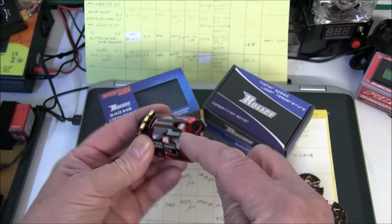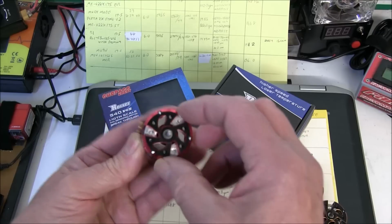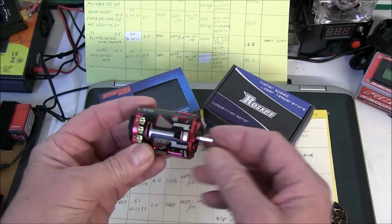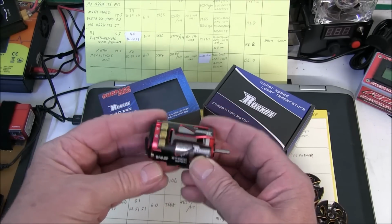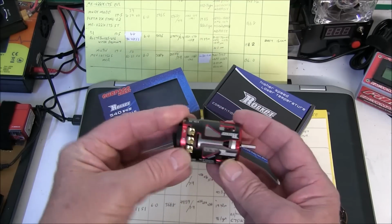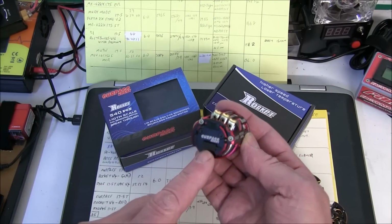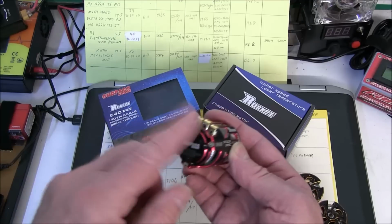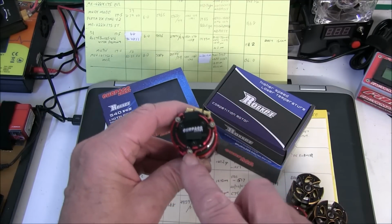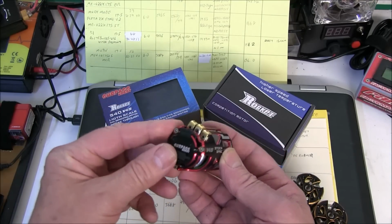Now the S version has the best collector at the front, which is a big aluminium collector, which seems to give exceptional performance in motors. We've seen it in the R1, for instance. Nice big tags for soldering, riveted so they don't move about. Some gaps, so soldering made easy for you. End bell, 2 sensor ports, makes it easy to fit in all sorts of cars. Even come with aluminium long screws, which you normally have to pay extra for.